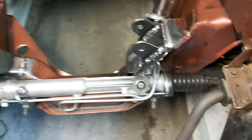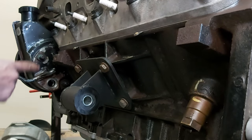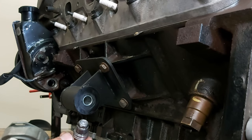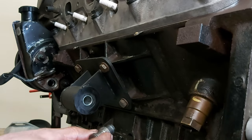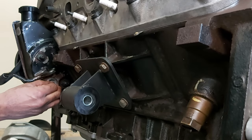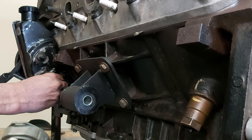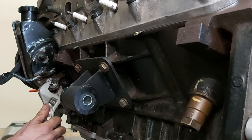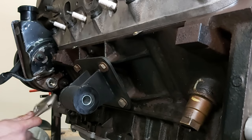So there's our factory Mustang rack and pinion steering, again requiring a thousand PSI to operate. As you saw on the bench, I replaced the shim pack under this little nut on our valve for our GM LS power steering pump. I've got three shims under here, reducing the pressure from 1,350 to a thousand PSI. So now we can use this pump with our Mustang or Fox body rack and pinion steering system. I just replaced also the seal — they give you the seal in the kit.